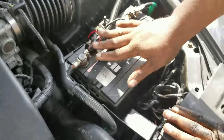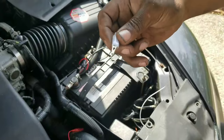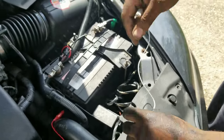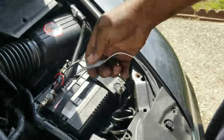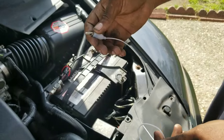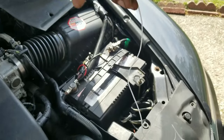I'm going to be using the car's battery, which is right here. I'll be using alligator clips — I'll put a link in the description showing the alligator clips. You can also use this method to test the blower motor fan in the car. Take the blower motor out, jump it to the battery this way, and if it comes on then you know the fan is good.